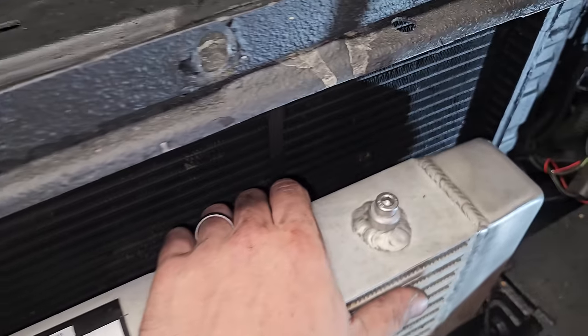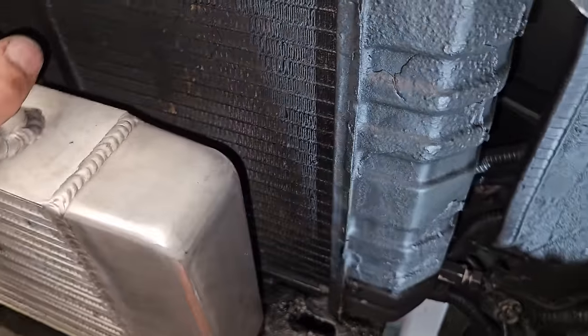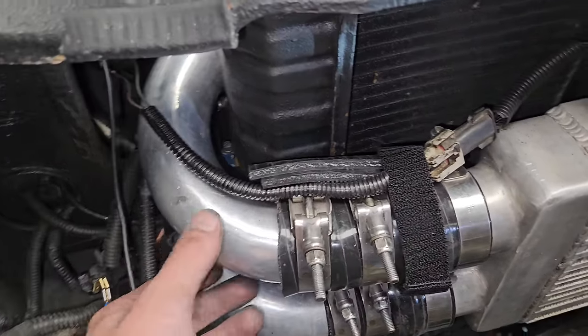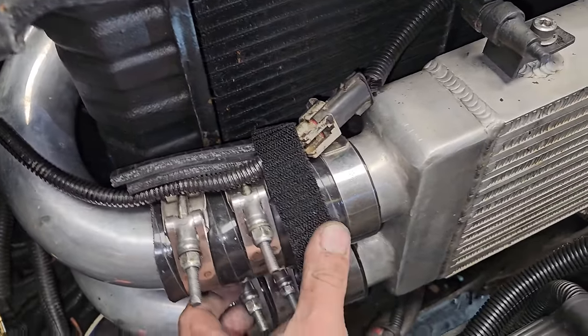There are a couple of poles sticking out under the radiator — normally they go into rubber bushes in those holes, but I've put some weather strip on the back of the crossmember. Mine actually slots in behind the crossmember and that's what gives me room for my intercooler. There's definitely enough space for plenty of air to get between them so there's no heat soak.